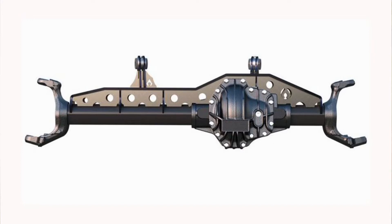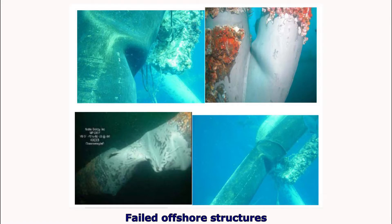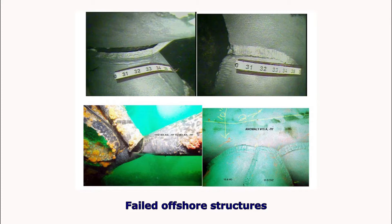I looked on the internet to see what's available and found a whole world I knew very little about, with many different strengthening kits marketed mainly in the US — but I didn't find a single kit which came close to the overlander's requirements. I accept that these kits are designed mainly for different clientele: extreme off-roaders, rock crawlers — and they have a very different set of design requirements, one of which would appear to be that the axle reinforcement should look the part and add street cred. I spent over four decades in the offshore oil and gas industry where structures were all subject to environmental loads, so avoidance of fatigue and fracture was just part of our working life. I also worked for a company which designed and built offshore platforms mainly on a fixed price basis, and for us the most profitable weld was the one you didn't have to make — and this does rather colour your thinking.